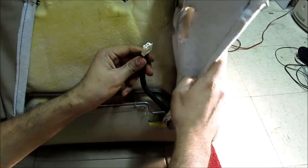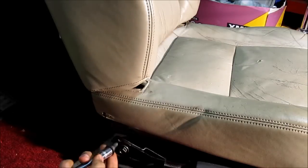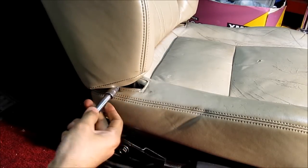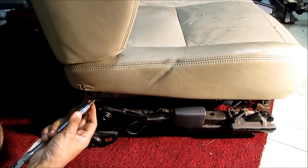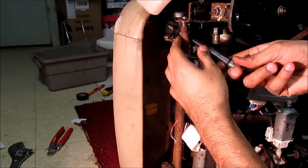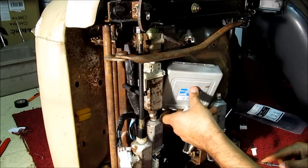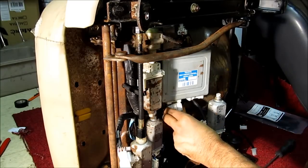Don't forget to reinstall the lumbar support wire. Then I'm going to replace the chair back. Next I'm going to replace the two 12mm pivot bolts that hold the chair back onto the seat frame. Next I'm going to replace the 10mm bolt that holds the recliner arm to the chair, then replace the four 12mm bolts that hold the seat cushion on. Next I'm going to replace the seat position control unit and all the wiring.